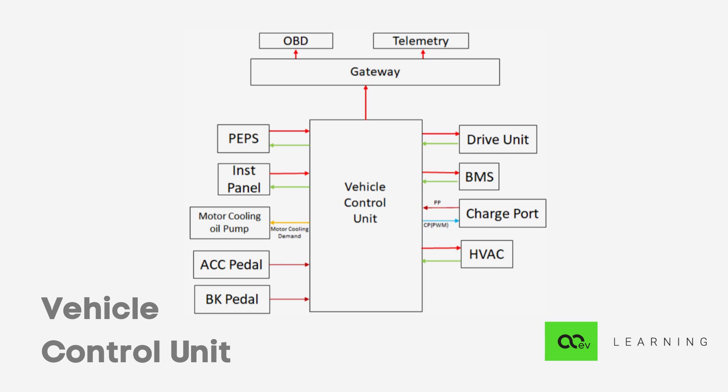This is how the Vehicle Control Unit's block diagram looks. A point to note is that in this diagram the blocks are represented logically. Generally, all of these communicating blocks are nodes on multiple CAN buses. As discussed earlier, the VCU is interfaced with the accelerator pedal and the brake pedal — that's the primary input for the torque and RPM to be delivered by the motor. The vehicle control unit then conveys this information in conjunction with various other conditions to formulate the motor controller demands.